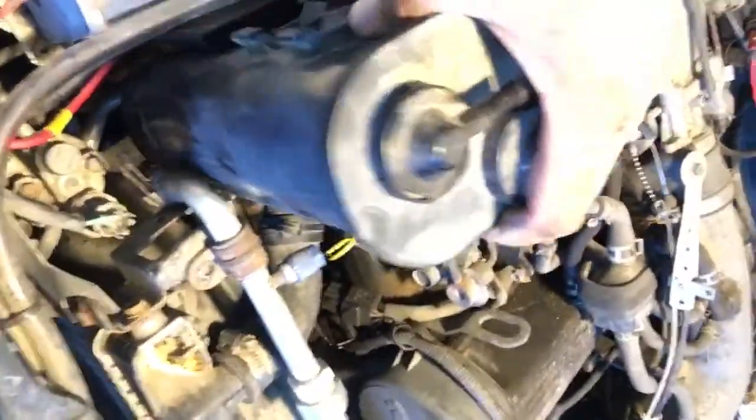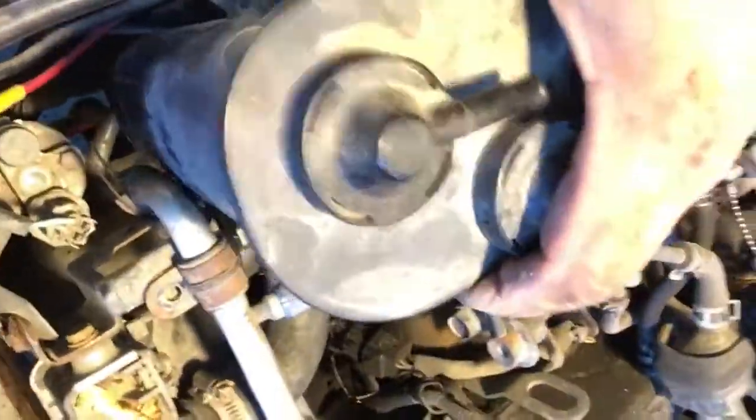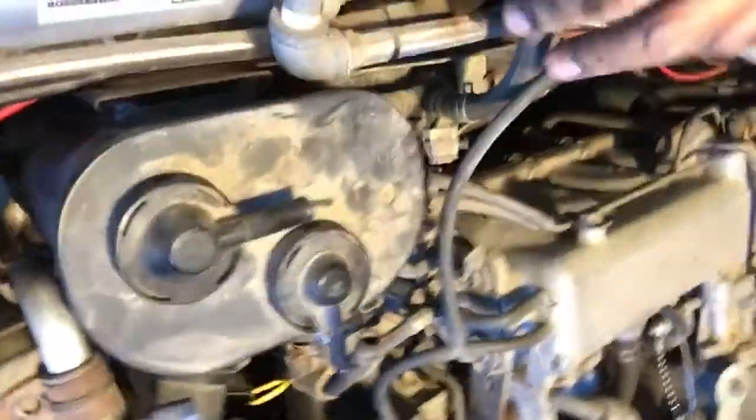I just went online, looked up the wiring diagram, which shows you which wires to reconnect to what. The big red wire that comes out of the plug just loops back to the back of the alternator where the battery cable is, and the other one goes into your factory harness that, if I remember right, just tells the system that it's charging, and it goes to this yellow and red wire. Depending on the clocking of the alternator that you get, you may have to cut some zip ties to get a little bit of length to hook up the power cable from the battery to the back of the alternator.